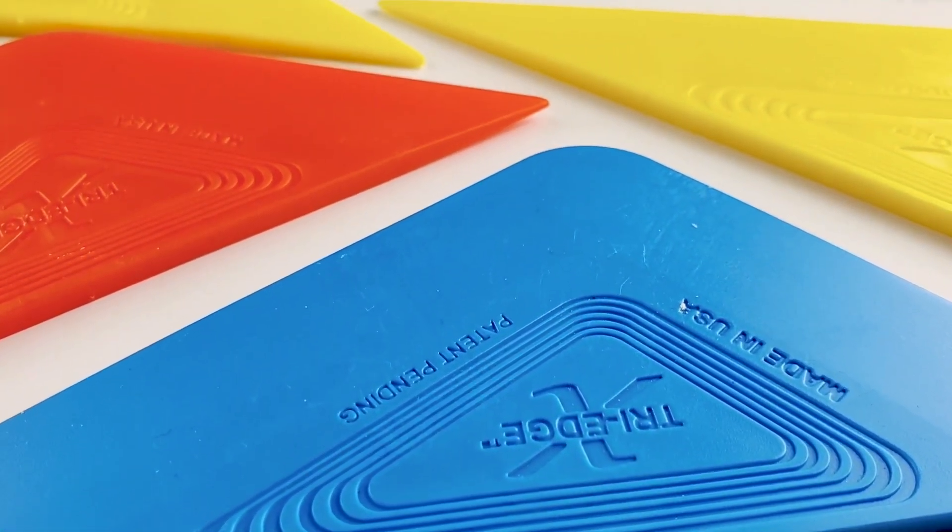Corner cards — very popular; you're going to use them. I'm dealing with the tri-edge cards right now, which are my favorite. There are easy reach cards, and I think Gator makes one, but I always go for the tri-edge. Three main colors you're going to see with the tri-edge: blue, yellow, and orange. The blue is my install blade — soft, flexible, doesn't seem to scratch. You can use 1000 grit sandpaper to buff the edges on your hard cards. The blue is a good install blade — it conforms better to glass curves and is soft enough that it really doesn't scratch tint.